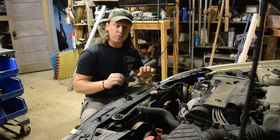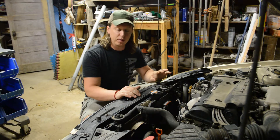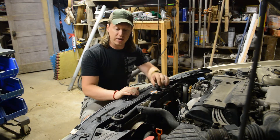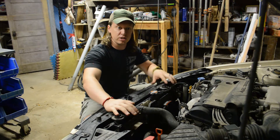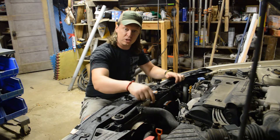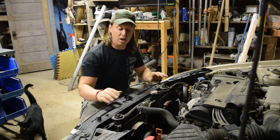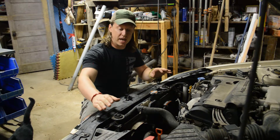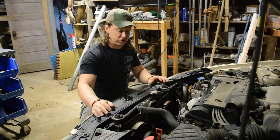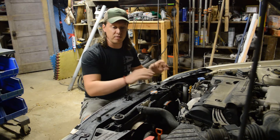Before we get started, I want to walk you through the steps we're going to take today. Switching out this radiator is going to be really easy. The radiator is only held in by a couple of bolts but it's got a lot of things connected to it — an upper and lower radiator hose, the overflow hose, and a lot of wires. This motor is mounted transverse so it uses electric fans attached to the back of this radiator. As you take things off, make sure you're noting where they go, in case it's something you have to move from the old radiator to the new one.